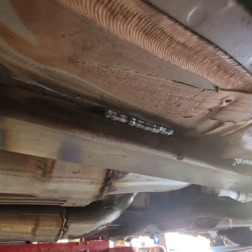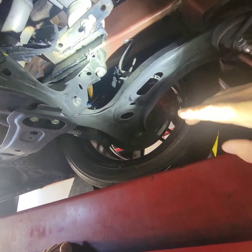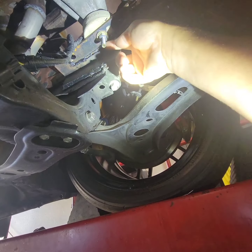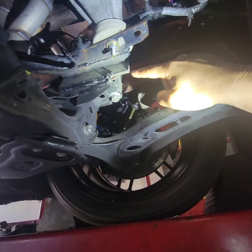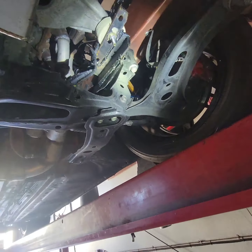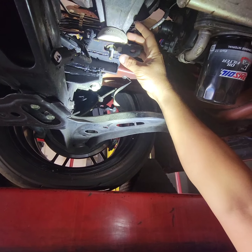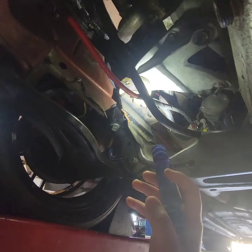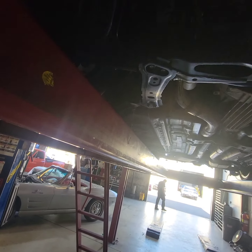Take a look at the motor mounts — this is a big one. It's like 3/16s: they took a piece of angle iron and basically scabbed a piece in, welding it at the face instead of butting it together, so that weld isn't very good. Luckily there's a big rubber bumper, otherwise this would just peel right off — you can see it's actually loose. It's all scab-welded. What we could do is support one side, cut that out, and refabricate a new mount. Start with a stock Mustang rubber or urethane motor mount and build a new cup for it, because if it falls the motor is sitting on the cross member. The other side is the same way — those are really the big issues.